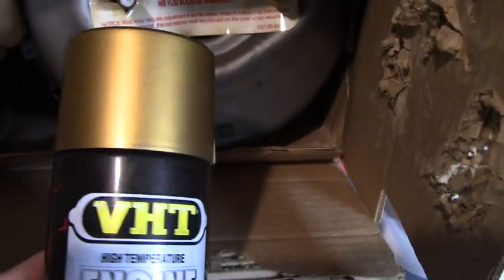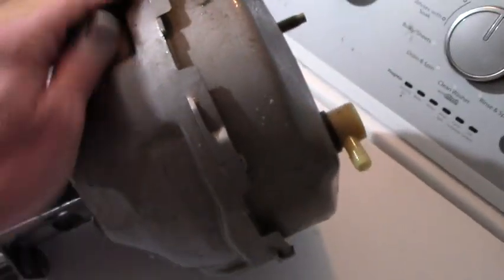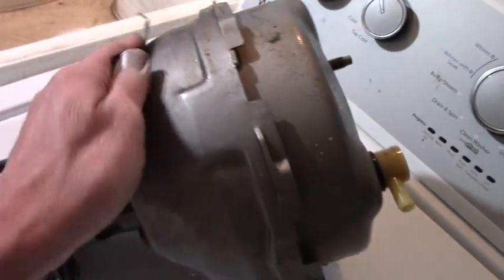For the brake booster I got a different vision — I don't think I'm gonna go gold like the old brake boosters were in the 60s. To prep the booster for paint, I'm just gonna clean it with Simple Green and some 320, kind of wet sand it with 320. That should get rid of the oil on it.